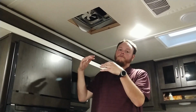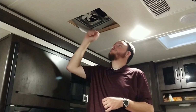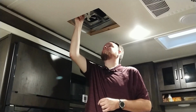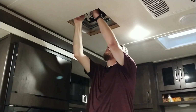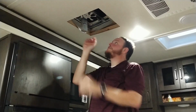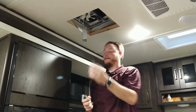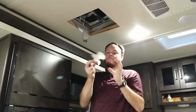Okay, so once you get the inner plastic off and you've taken the little plastic deal off of the power switch, there's 2 screws for the power box, but honestly you just wiggle it back and forth a little bit, and there's 2, like, I don't even really want to call them spot welds, but almost like a spot weld, that you just wiggle and it will come off. It will eventually break off like that. So then what you do is there is a zip tie. You can take scissors or something. I'm just taking my pocket knife. Cut that. Take that off so it's not dangling around in your new fan. And then you take off puny little fan.